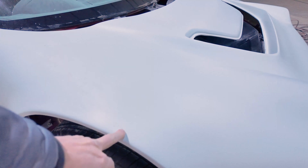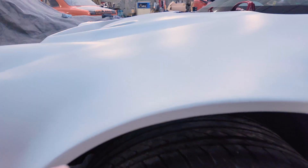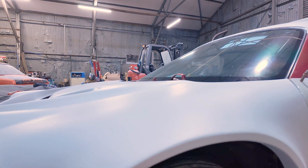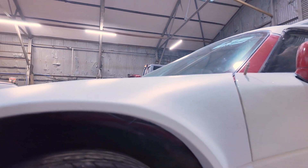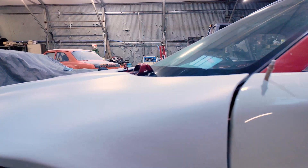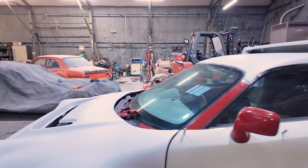I've got pinholes to do — go around and get some filler into them while I can see them. And then I'm going for these edges. It's stuff like this — can you see that? Yeah, see that little line there? It's like a double line but there's a little ridge there. And then there's a sharp edge there, so it all needs rounded off right the way around. Put a pinhole there — again the edge is a bit sharp there, so all that needs softened, all that edge needs rounded off. And obviously some pinholes. I'm going to get the bits that I can see before guide coat because it'd be hard to spot stuff like that when it's guide coated.